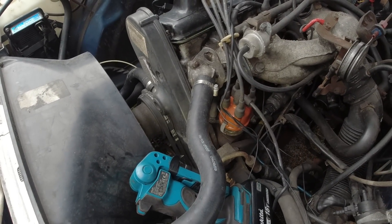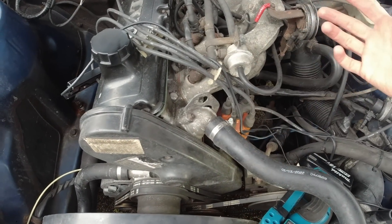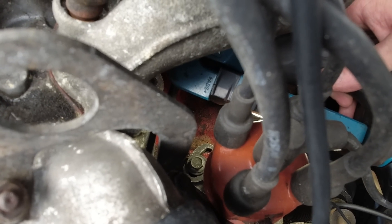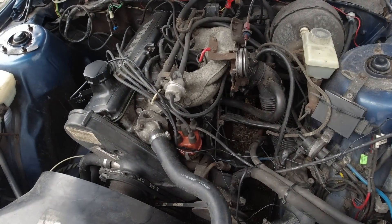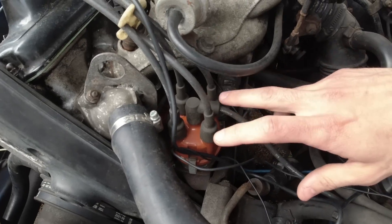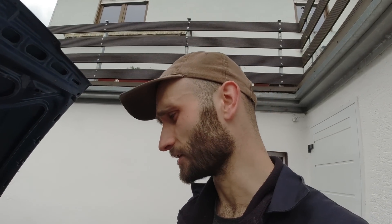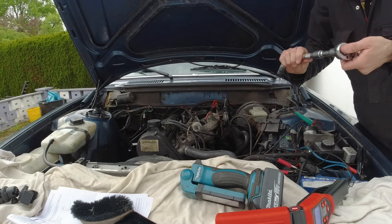We're going to test it so let's fire it up and see where it's at. One thing we should do - because we're probably going to adjust it - is get in there and just loosen the distributor. That nut there you can get straight down on and crack it off. You don't really want to turn the distributor before time, but it should turn. Don't be surprised if it doesn't - that's usually the hardest part of this job. Thankfully we had this one in recently with some grease so it moves nicely, so hopefully no issues there.